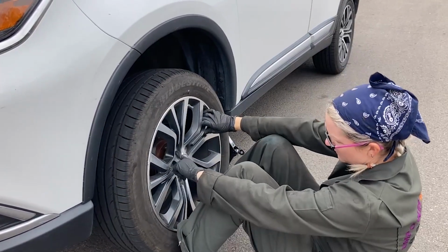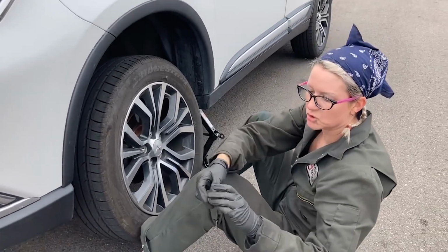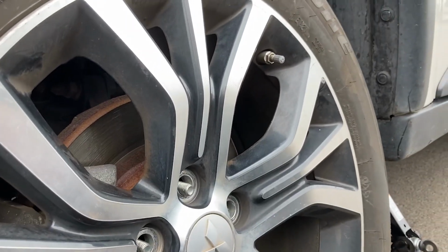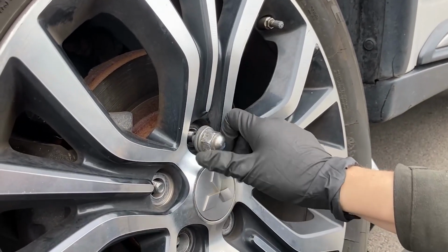And then I'm actually gonna rotate this guy a little bit. And then you're gonna find your favorite lug stud and your favorite hole, and then push. Now, like I said, because these have a shoulder on them, can you see how these holes don't complete a circle? You're actually gonna have to lift with your toes to get this to be able to go in. Okay, so that's why we use the two-toe method, especially when you have a shouldered lug nut.